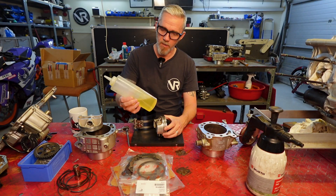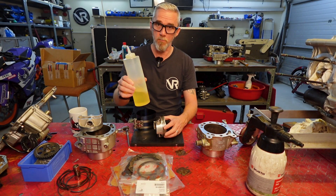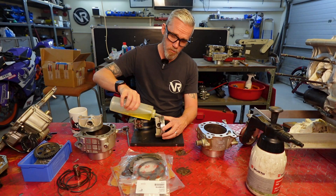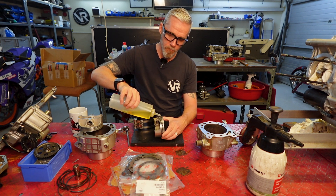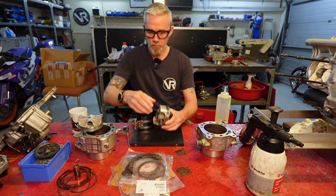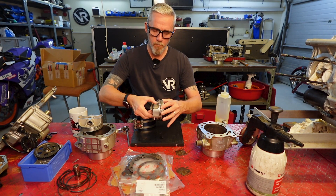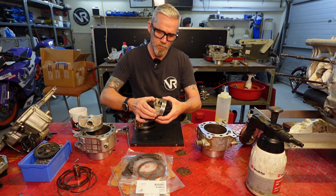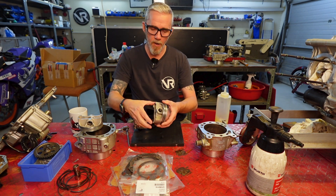The oil I'm using here is actually a lubricant additive from Zeto. It's got a really good lubrication property - you're supposed to add a certain amount to your sump, but for rebuilding engines, because it's so thick and has such a good lubricating property, it's great for stuff like this. We're just going to put a little bit on and prep all the rings. I just want to make sure the rings have got a bit of friction with the oil so they don't move around as much. Once this oil's worked in, we're going to stagger all these rings so they're all opposed to each other - so there's no one straight path where the gap of the rings lines up.